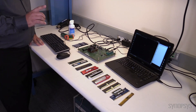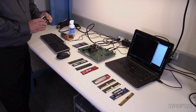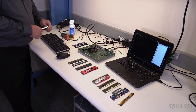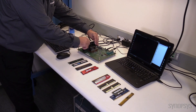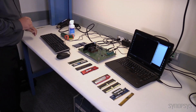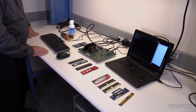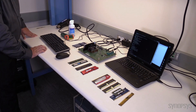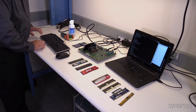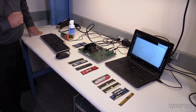What I want to do is start off and show you — as Mark said, this is our 3200 megabit solution. I'm going to take a DIMM that probably has some 2400 devices underneath it that have been speed-binned, now rated 2800 by the DIMM manufacturer. We'll pop this in, turn on our board, and run it. We'll start simple, running at 2400 megahertz. Everything is trained up nicely, and we can take a look at the data eye running at 2400 — the likely rated speed of the DIMMs.